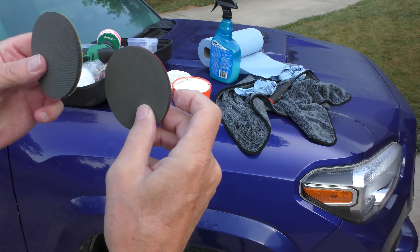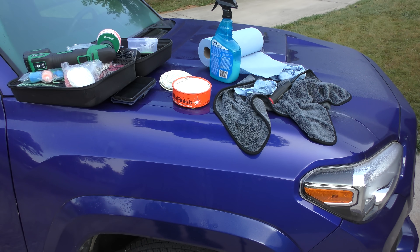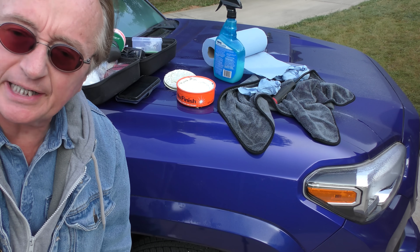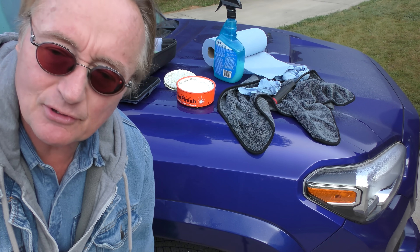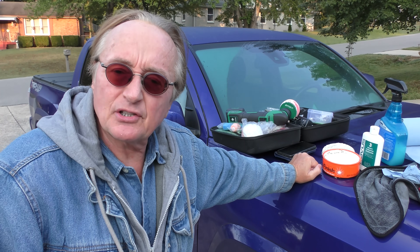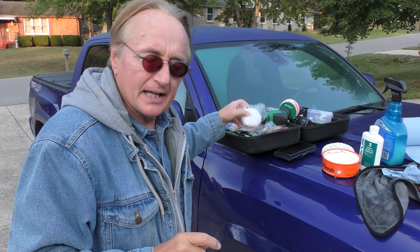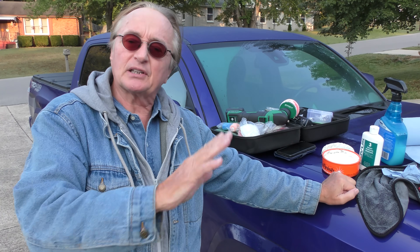This Batolka polisher comes with all kinds of stuff — these are different grit sanding pads — but we're not sanding in this case, we're just going to polish. If a lightweight polish doesn't work, you can get a heavier scratch remover. There are various levels, just like sandpaper: rough, medium, fine, and extra fine. In this case there are just some scratches on the paint — you really don't want to use sandpaper or even the abrasive pads that come with this, because you'll easily take the paint off. Then you're going to have to repaint the car, and even if you only take the clear coat off, you're still going to have to re-clear coat that area with clear spray paint — it's like clear fingernail polish.